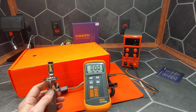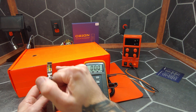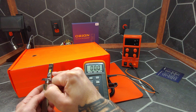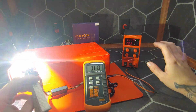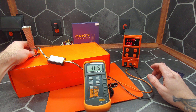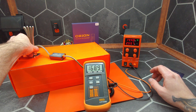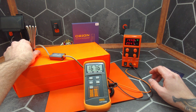Alright, let's grab the second bulb and get some quick measurements in the light box. We have our light meter set to times 10, as always. We're going to be using the high beam chip rather than the low beam because of the shield, and we'll start by facing the darkest portion and rotating it until it faces the sensor to get our highest point. At its lowest we're around 480 lux, and going up to max we are at just shy of 1,700 lux depending on orientation.